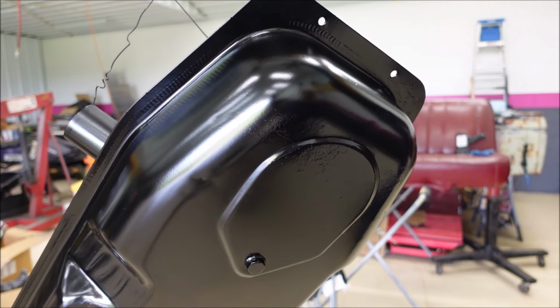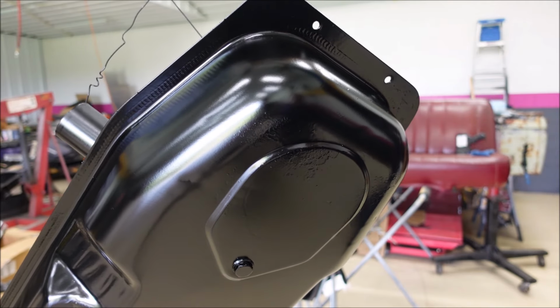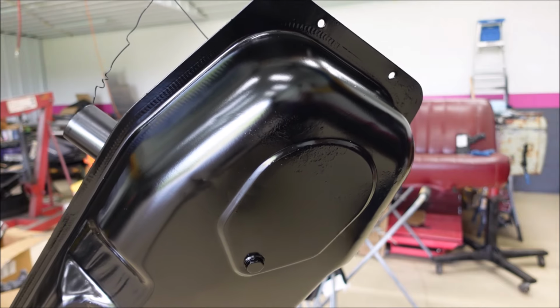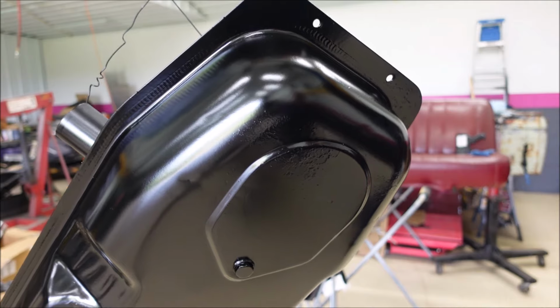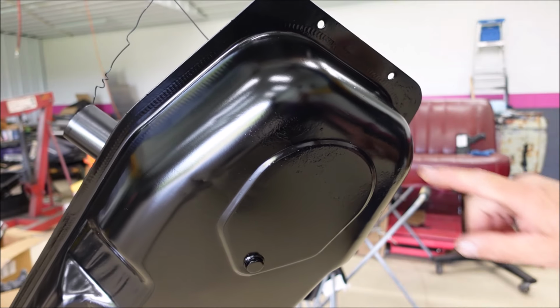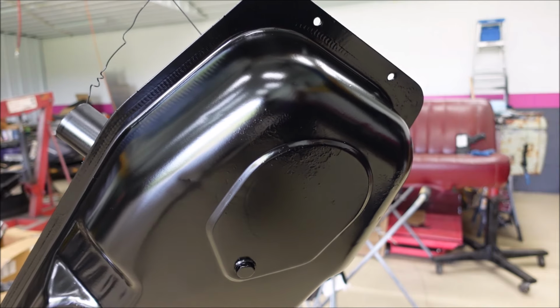I moved on to the paint. I used slow reducer instead of medium. And I sprayed it just the same as I did the sealer. I was pouring it to it, so I made runs. I tried to get the runs out with some tape. That's what you're seeing here. And then I said, I'm just gonna spray over the top of it to finish up the job.